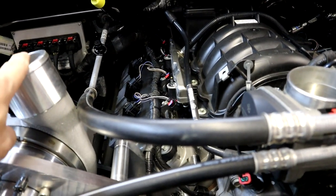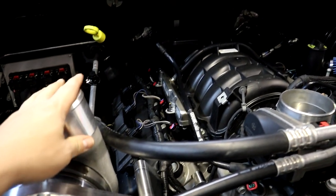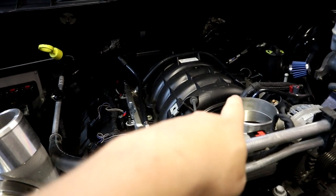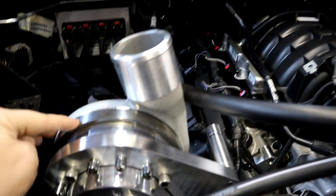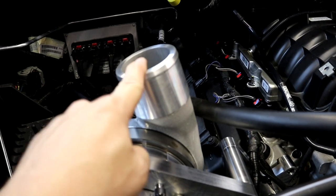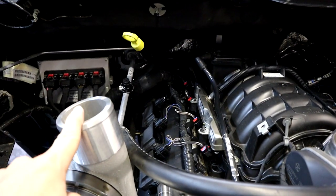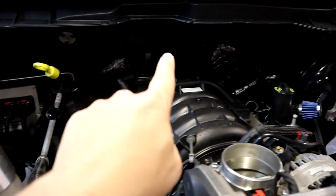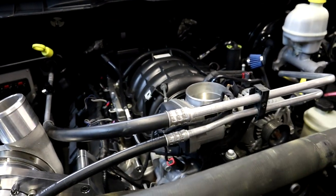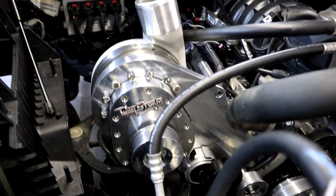This is not going to be an intercooler setup — it's going to be a water-meth setup only. We'll have a short pipe running from the top of the supercharger to the throttle body. We've already loosened the band on this Torque Storm supercharger and clocked the outlet going up, because we're running a 90-degree fitting from here, and then over — and our other pipe will have a 90 already made into it going right down into the rubber coupler. That's the plan.